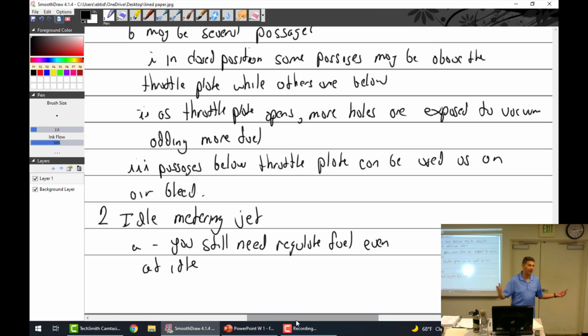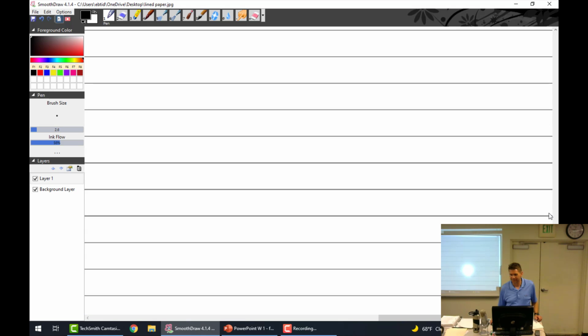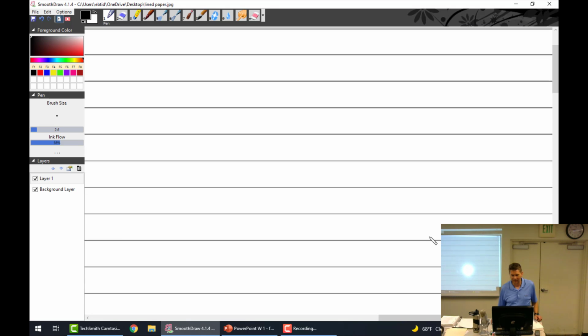All right, so we're gonna take off with... Well, I gotta remember where we are though. Oh man, I touched the thing. What was it supposed to be at? 2.6 inches of mercury. All right. 2.6. So what did we just do? Okay. So two. No, we're on three. Yeah, we're on three. Idle mixture adjustment.